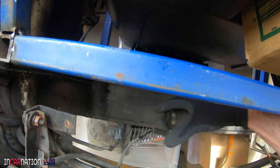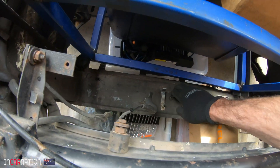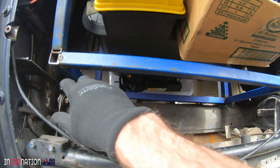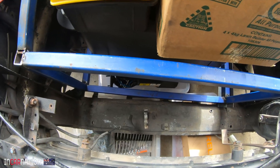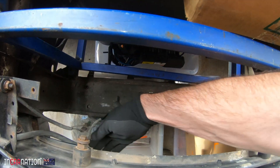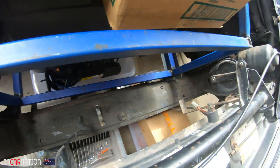In the front we're going to do another one — a long radiator along here. We've got a rail there and existing mounting points. It'll be 700mm long, 200 deep, and quite narrow. It'll probably sit at an angle and it will be complete overkill for the job it's got to do, which is to cool the battery.